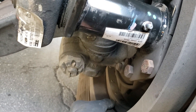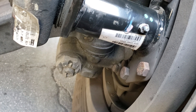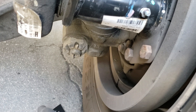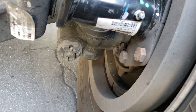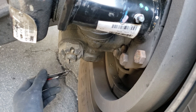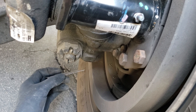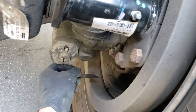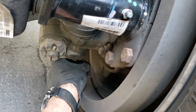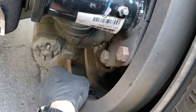What we're looking to achieve on these adjustments — and you do have to do these periodically — is no more than about 1/32nd of clearance between the two. That's how tight we want them. The easiest trick is to take a business card; standard thickness on these is about the same as what the clearance is supposed to be. Ideally you want to barely just be able to slide one business card in between the drum and the shoe, just like that.